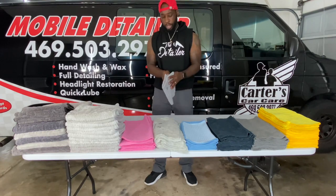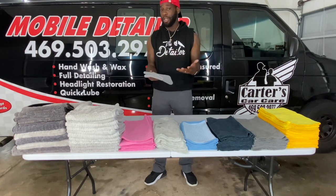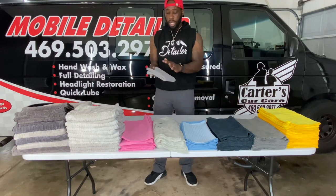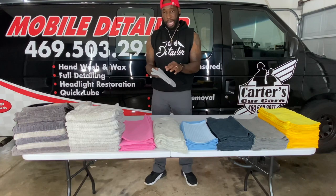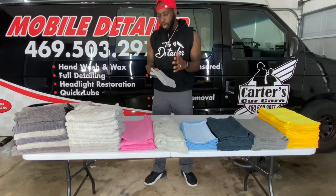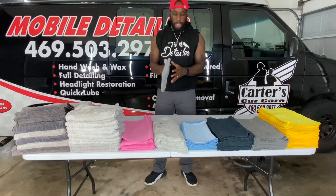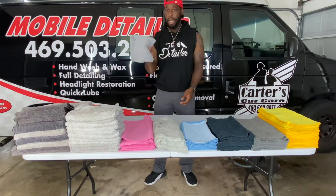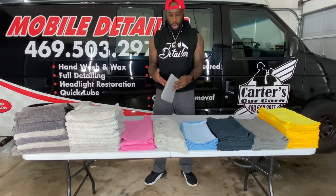Because when you're wiping off any kind of products off the paint, you don't ever want to confuse yourself on what side of the towel you're on, especially when it comes to coatings. After a while, the coating will start getting clogged up inside the towel, and then it'll start crystallizing and hardening, and then you can possibly start to scratch and mar the paint. You don't want to do that. So you wipe it off a few times with one side on one panel. Then, once you get done using this side, you flip over to two. You got a fresh side. Boom, 2. So this way you never lose track of which side of the towel you're using.